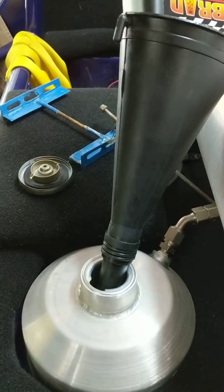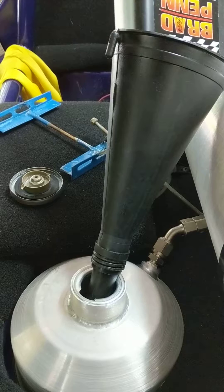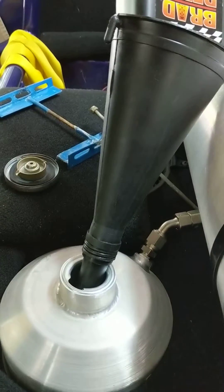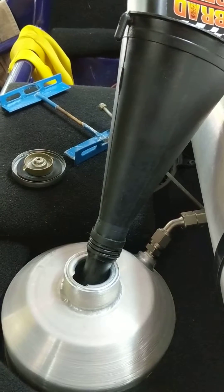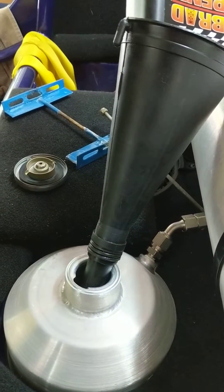Because this is my very first time running the engine, and the tank and engine are bone dry, what I'm going to do is put several quarts in — maybe two or three — and I'm going to let this system gravity feed. Gravity feed, or what some people call prime, means I'm filling the tank and gravity is going to allow the oil to come out the bottom feeder, which is right here.